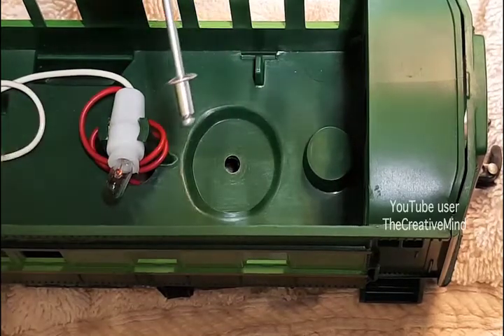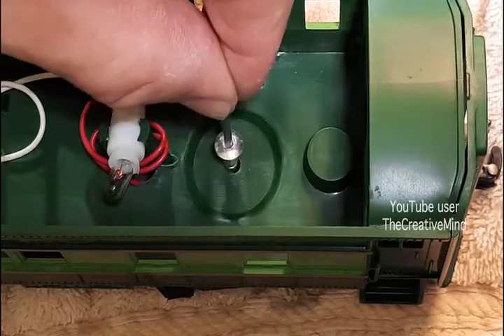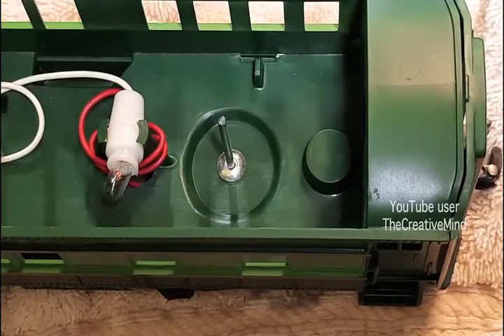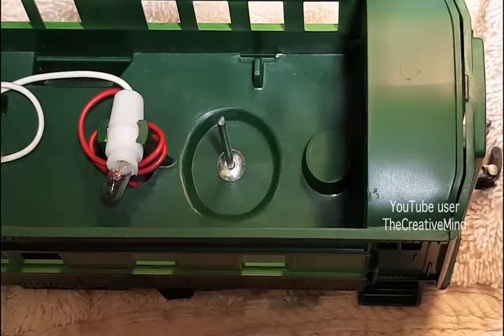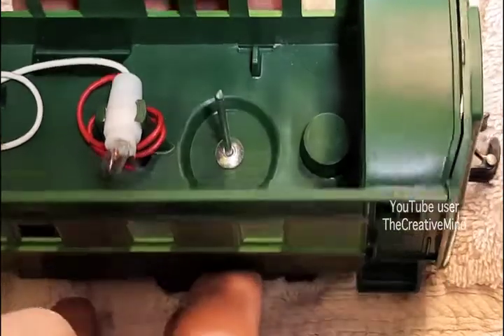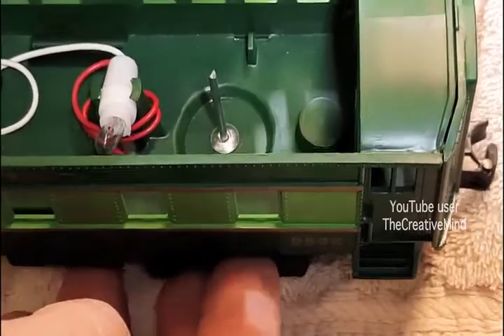If you use a longer shank, just make sure it does not interfere with the center rail pickup. It fits nicely inside the hull — very snug. However, if you just rivet it straight in place, the truck is going to be adhered to the body of the car and it's not going to turn whatsoever.